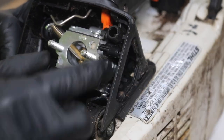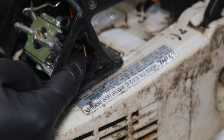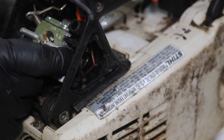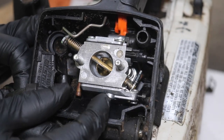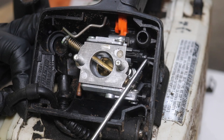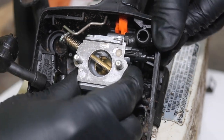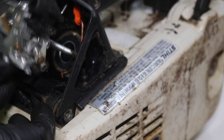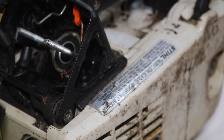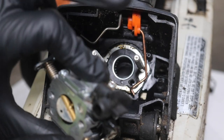Now let's slide this right out of here. There's still a throttle linkage — see that copper-coated linkage? That's our throttle line. In order to pull this out, you may have some resistance between this knob and the plastic case, so you may have to push the case, and then it should slide out. And it looks like our throttle linkage came right off. The old carburetor is out.